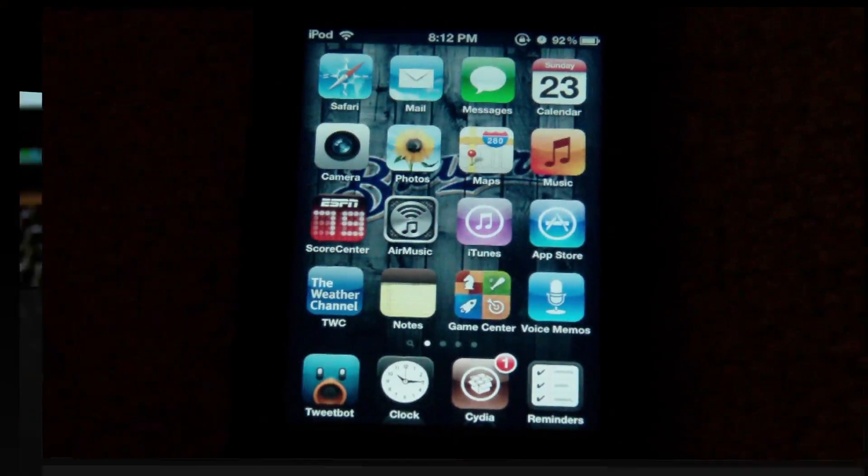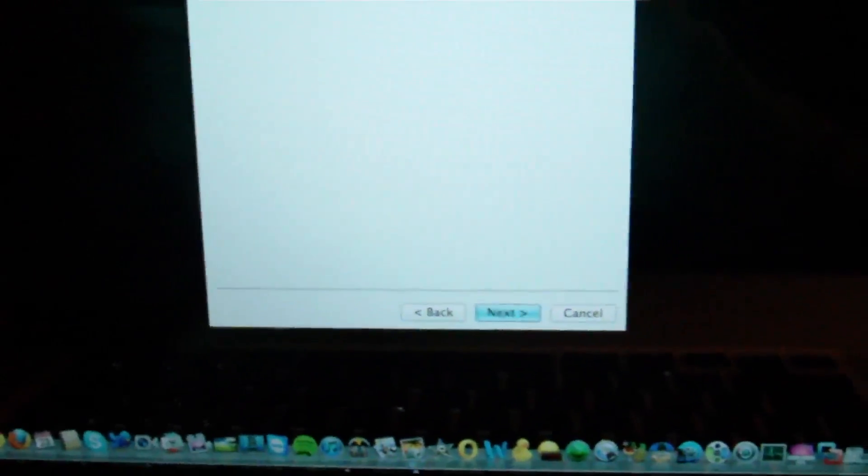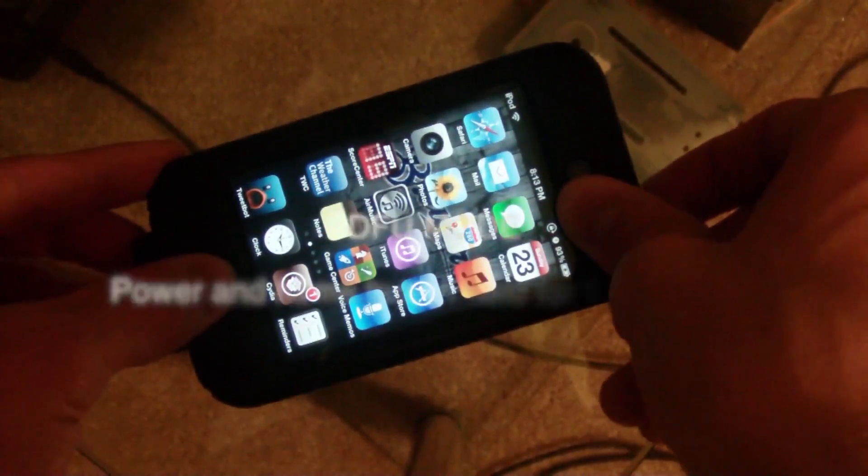I'm going to show you that now. You can see I've got redsn0w beta 7 here and my iDevice in the same state as before — just rebooted on the semi-untethered. We're going to go ahead and open redsn0w and hit Extras, then Just Boot. It tells you to enter DFU mode on the computer — it explains to turn off your device and hit next. We're going to do DFU mode right here because it's easier. You can see exactly how in my jailbreak tutorial.